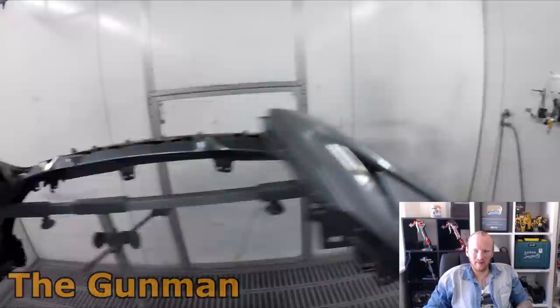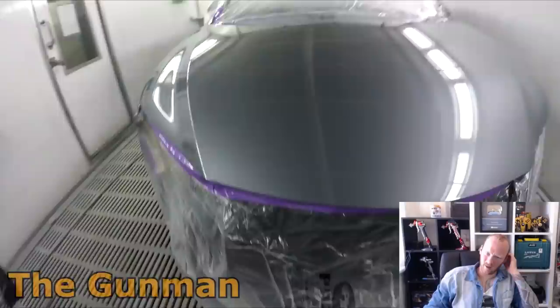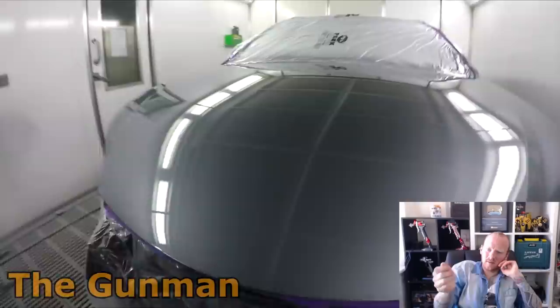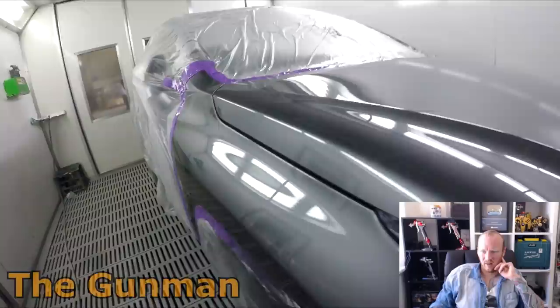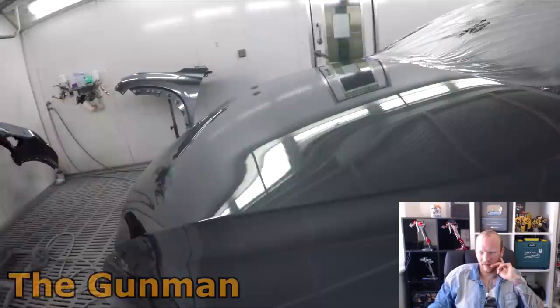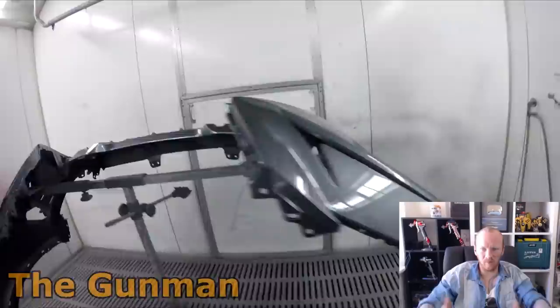That glass finish is lovely — loving that Standox clear. There's a nib or two here and there but they didn't take long to polish out. These days I mostly just use my tungsten de-nibbing block — I might put a link to it in the description. Just nib them out with the tungsten, get the buff, and melt it in a little bit — you don't even need to sand them most of the time. There's a window of perfect time to polish: anything over five days it gets too hard and you'll need to sand it. Two to four days you can just tungsten it out. That's it for this video — hope you enjoyed it, give it a thumbs up, and until next time, get out there and paint some shit.